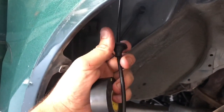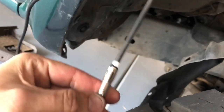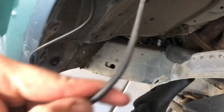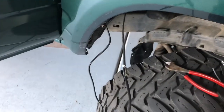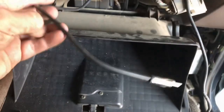All right, so that hot water trick worked like a dream. So now, got the old cable coming out. I zip tied, I stuck the end of the antenna plug in there and zip tied it real tight. And now I'm going to electrical tape over it and make a smooth pass. That way when we pull it through, it'll just be one smooth motion and follow the original path, hopefully. And we get it in there and make it all work. The antenna looks good. Hopefully we'll just have to kind of pull this cable, the old one, and it should just kind of bring everything over and in, and then we could just button everything back up. Well, that ended up working out pretty well with the zip tie and the electrical tape.